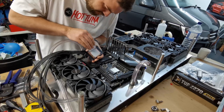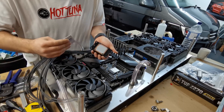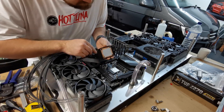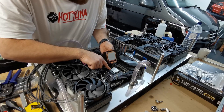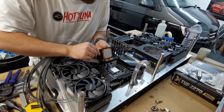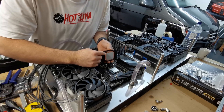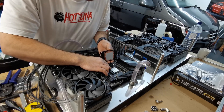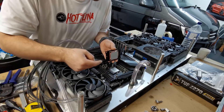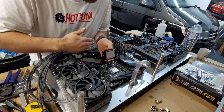You don't have to be super neat with it, but what's important is that you get a thin, even layer. If it runs out at the edge you can just drag it back the other way. What you end up with is a layer of thermal compound that's larger than the heat spreader, so when this goes down you're going to have even contact across the entire IHS. Keep it as thin as possible because the thermal compound is not as good at transferring heat as the copper heat block or the metal IHS — which is why people use liquid metal like Thermal Grizzly, because the metal is just better and the heat can travel through it faster.